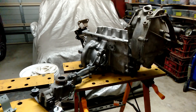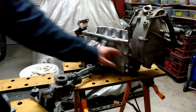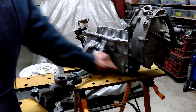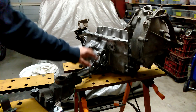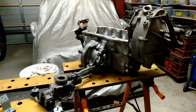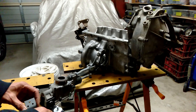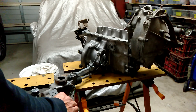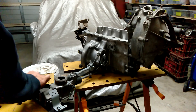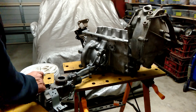So I've decided to go to the effort of — this is just an empty gearbox case with a few bits and pieces — just to put all of this together. That will then sit into the subframe. You need all this on just to have the mounts which connect to the subframe. I've bolted that on there and obviously we install it, then underneath the car I'll connect all this up so we can get the spacing correct, or as close as it should be. So these brackets, I've put some weld-through primer on. I'll just put them on here for now, and I'll have to do more adjustments. I'll need to put the subframe into the car first — I think that will be the easiest way.